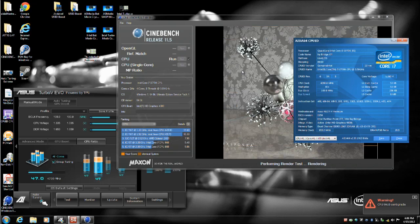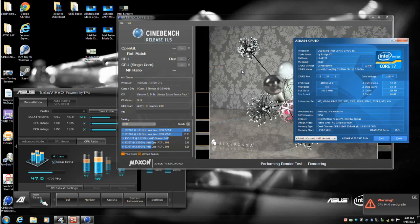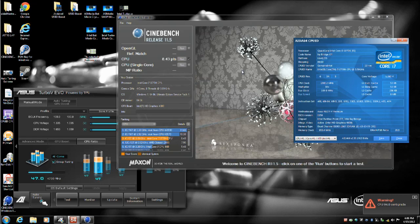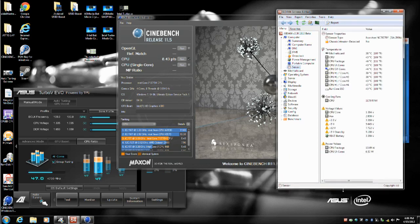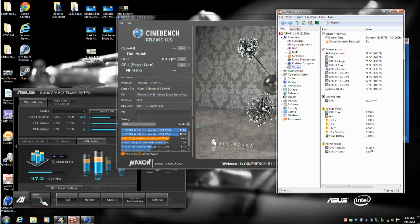You should always use the applications or games you're actually going to run as your benchmark for stability. Worst case scenario, it might fail under Prime 95 or even Cinebench, which has similar power draw levels to high stress test applications. But if all you're doing is running YouTube, Microsoft Office, watching online video, and playing games, you might be able to get away with a high overclock that wouldn't be stable under full stress test applications — but if it's stable under your games, it's stable. There's a relative degree to what you want to quantify as stability. Also, using something like HWiNFO, you can reference wattage data — which not many people account for, but it's a good marker to understand how much power draw is occurring when you overclock, which is also relative to heat output.